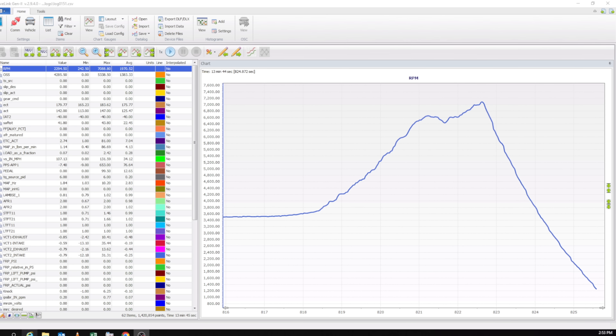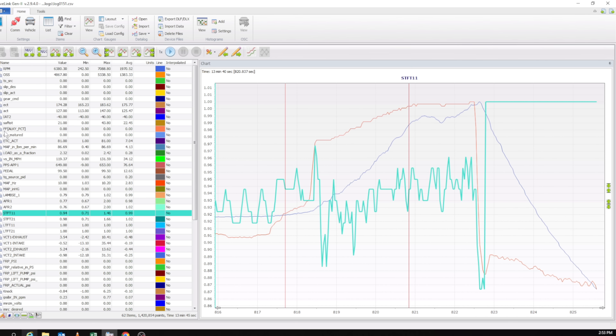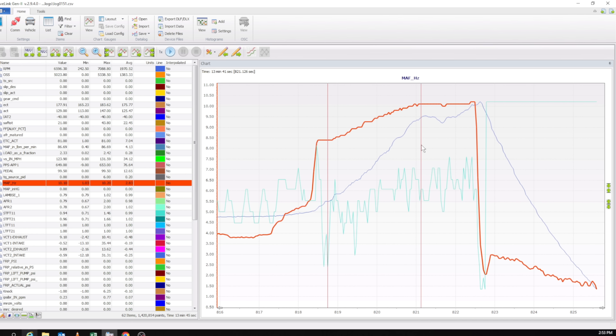Let's take a look at the data log after installing the idler. It's very obvious what happened: the RPMs were on their way up, it would have been hauling the mail, but MAP frequency flatlined — that's a telltale sign of belt slip, because MAP frequency should keep going up with RPM and it just did not. Fuel trims are good, fueling is good, spark is good. It generated 2.4 air load, probably stuck at around 17 psi, because the MAP frequency just did nothing. Unfortunately the idler and new belt routing with the six-rib belt is still not enough grip on the supercharger pulley.